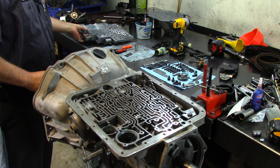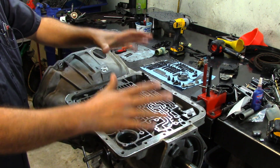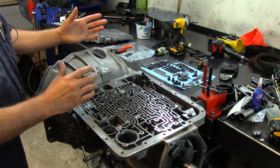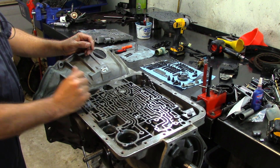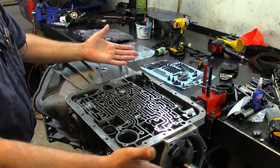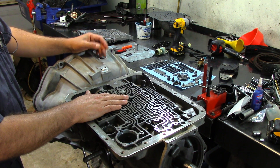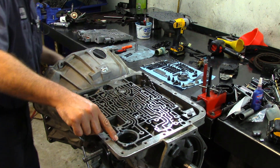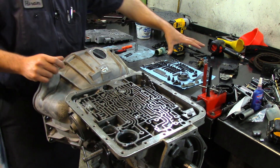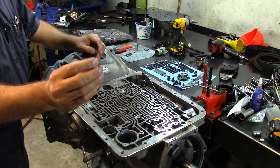Let's say you're at the point where you already got your valve body ready for installation — it's already done and you just want to go ahead and finish the installation, install the valve body to the transmission. So, with nothing on the case like you see here, in this hole right here is the 3-4 accumulator. We already have all of our bolts identified.